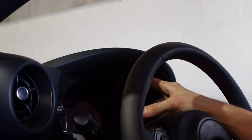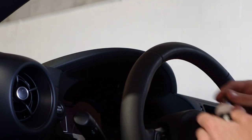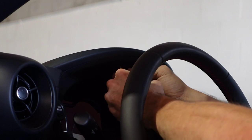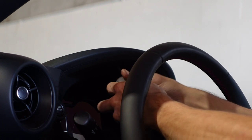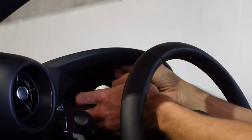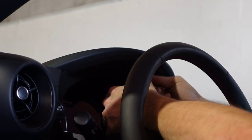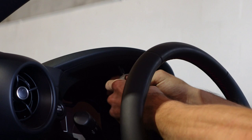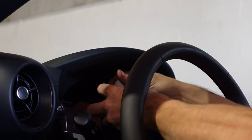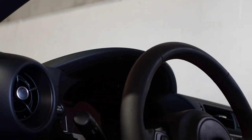After that, we're good to go. First step: go ahead and locate two screws — they're either 10 millimeters or Phillips heads, whichever. They're not in there very tight, so I'm going to use the Phillips head. Once you get on it, go ahead and loosen it right up. Once you get into your own car, they are definitely there and will be very easy to find. What I like to do is sit them in the shift boot — or if you have a magnetic tool tray, use that — so that way you don't lose them. If you lose these, you might get vibrations and your dash won't seat together properly.